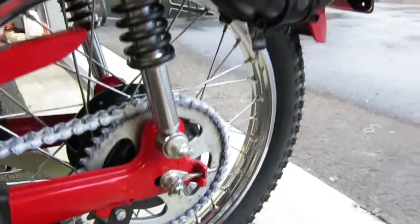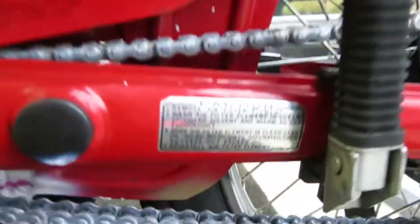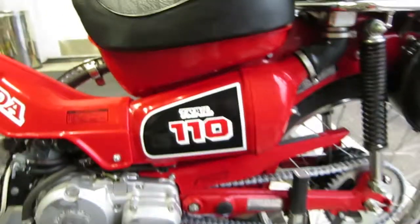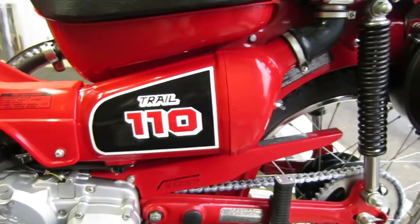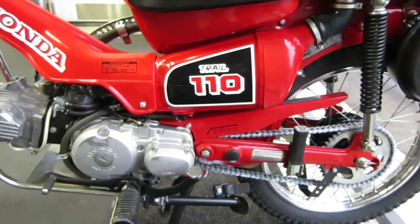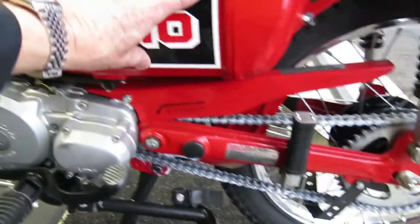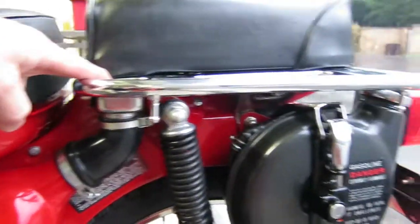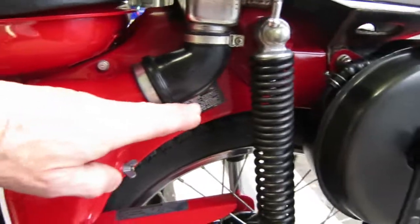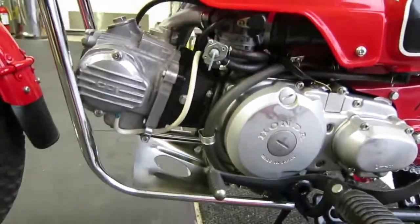You can see the condition of the chain and the chrome rear fender. Here are all the original labels on the bike. What's really interesting is Honda made this little Trail 110 so that the air intake to the carburetor is here, but it goes through the air box which is all sealed, and the air box draws its air from way up here just underneath the luggage rack. So you could literally go through water this deep and have a sealed system and drive right through, like a creek, which they were really famous for.